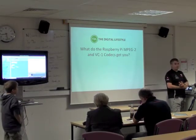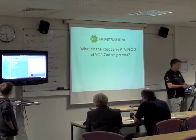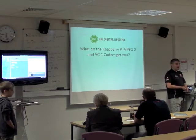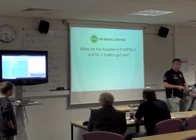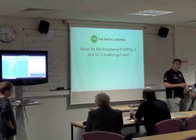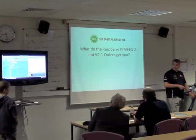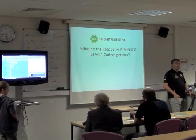One of the limitations when it first came out is that there's no MPEG-2 support in the Raspberry Pi — it's a commercial license. So you can play H.264 files, MP4 files, but MPEG-2 wouldn't work. DVDs use MPEG-2, so you can't play DVDs. I used Windows Media Center to record TV as a DVR, and you couldn't play those on it either, so it was a bit limited.